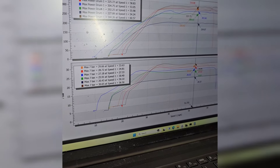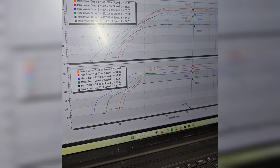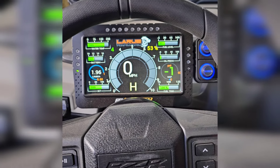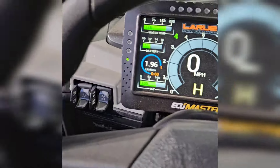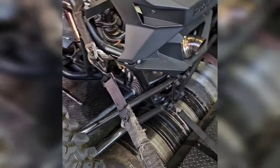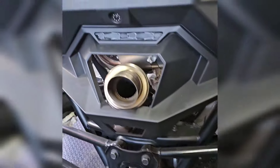This thing is making 344 wheel horsepower at 14.5 pounds of boost. That's pretty good for a stock motor, considering this thing made 165 wheel horsepower stock. Tomorrow we'll add more to this video — we'll be changing tires because these things were just starting to slip earlier on the low end. You can see some rubber on the ground down here. We'll put on the slicks, stop spreading rubber all over the ground, and turn her up.